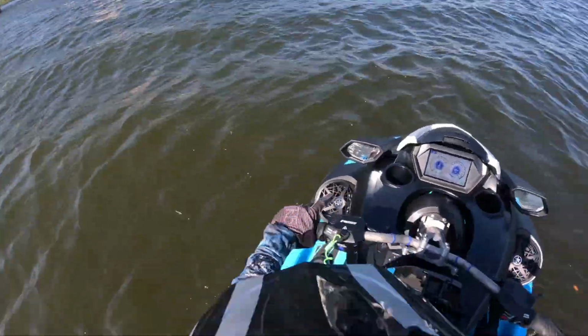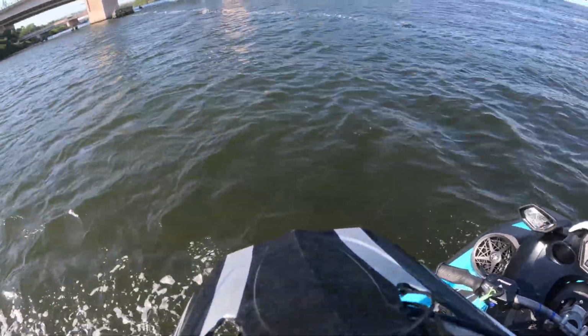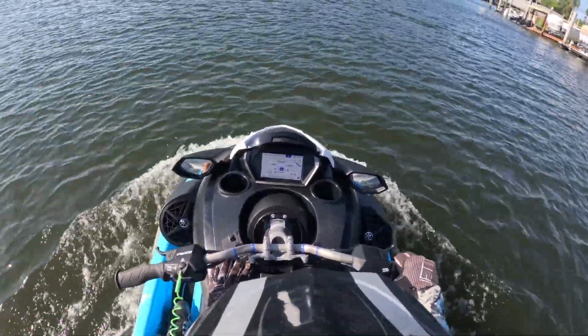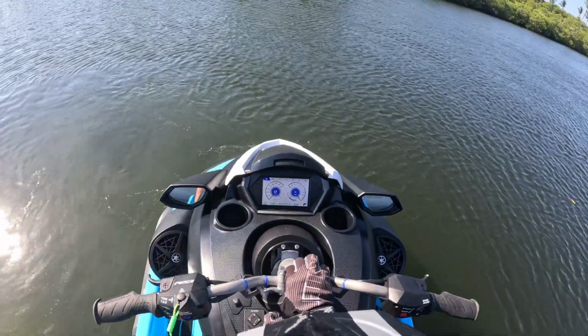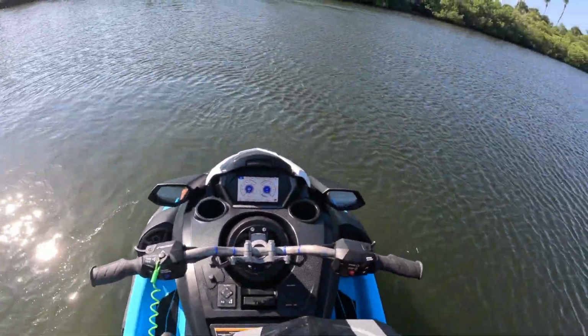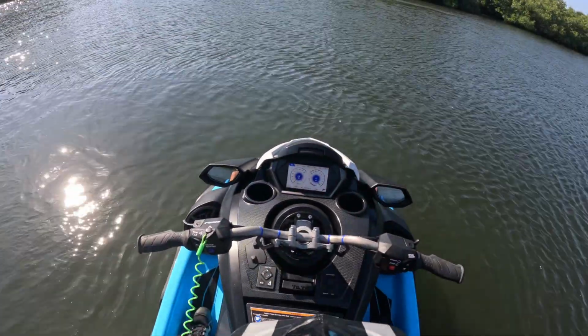All right, so 5 minutes. So for 5 minutes now, we're gonna let the ski basically idle. All right, so my first 5 minutes under 2,000 RPM are done. And I shut the ski off, and now I'm gonna let it just cool down for 5 minutes. I'm just gonna hang out here.